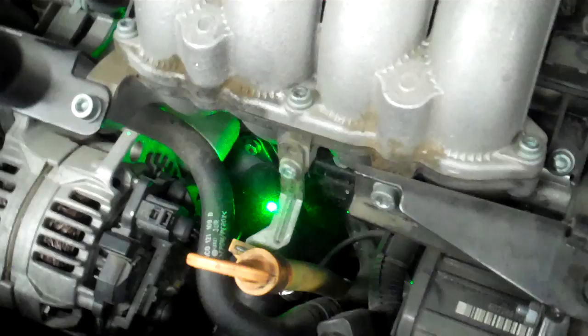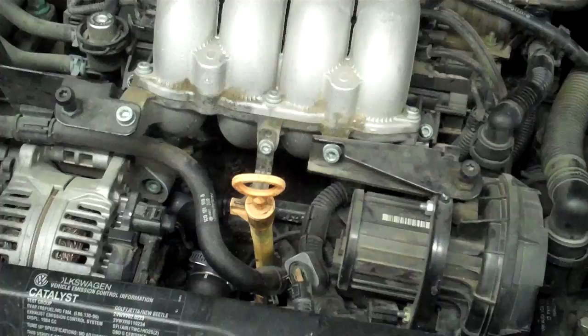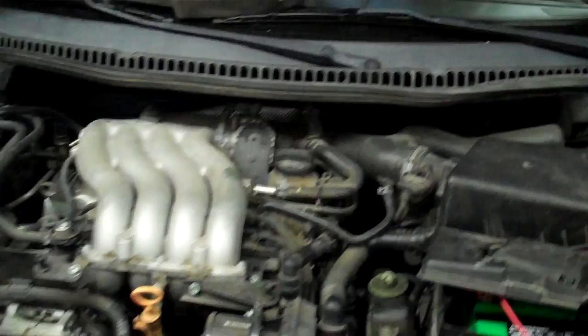In terms of what's been done already, the water outlet and the thermostat have been replaced and it's had a tune-up. But it's still having a lot of trouble when it gets down to quarter tank and you turn hard — it cuts out. That's a fuel pump issue. And then also it's still overheating.